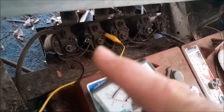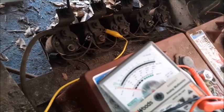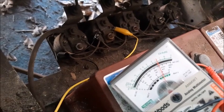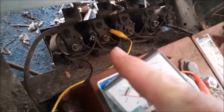Since we had power on the first one, let's go to the next one. As I begin to press the pedal down, you can see I get power when I get close to full throttle — not quite full throttle — and then finishing to full throttle we get the click on the last solenoid. That tells me that the solenoid in the number four position is bad.